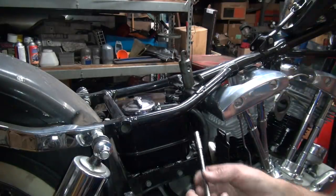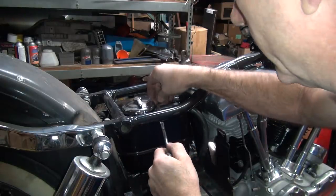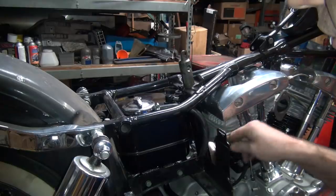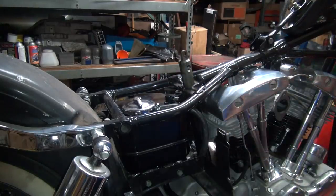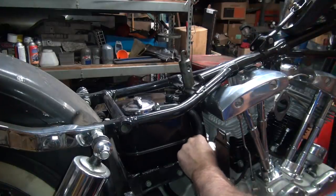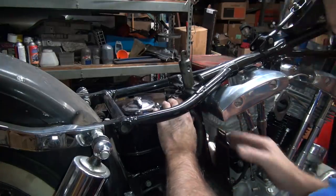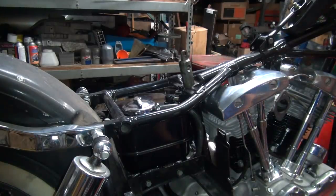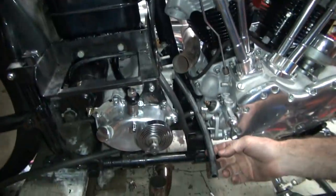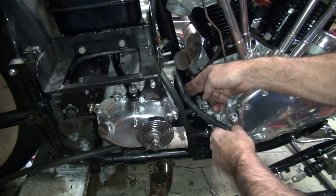I can go a little closer. Does the sixteenth make a difference? Yeah it does. Now we know we're definitely on top of the nipple real good. Now you rotate this down a little bit, find a good spot for that. There's another hose going across there. This has a pre-curve bend in it right now — see it wants to go that way already, naturally down here. We're taking advantage of the natural bending line to go right into our fitting pretty close. Still got to twist it a little bit but it goes in there pretty good.